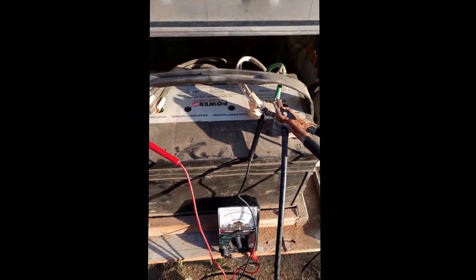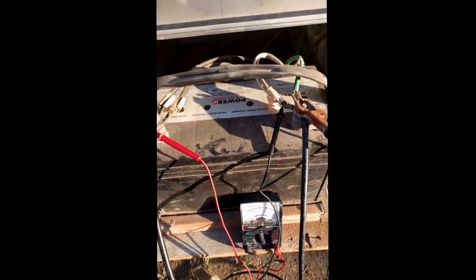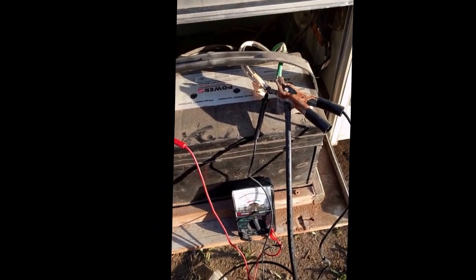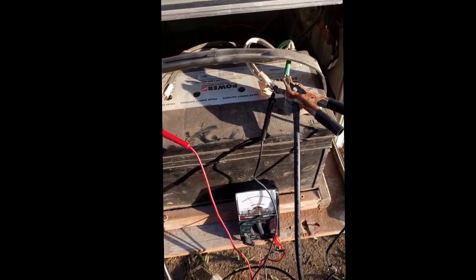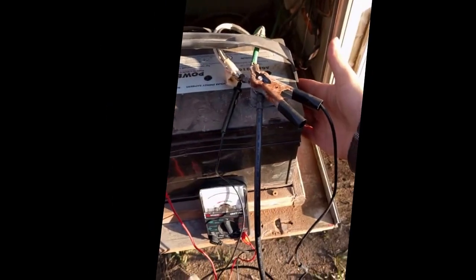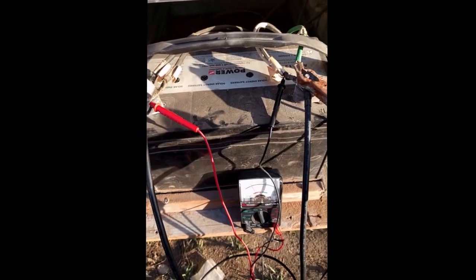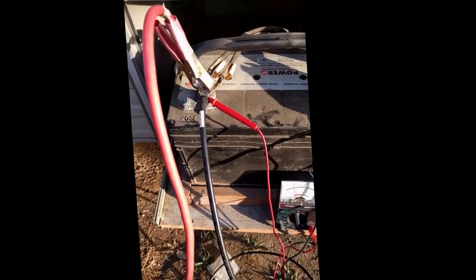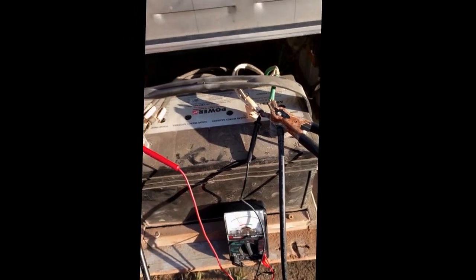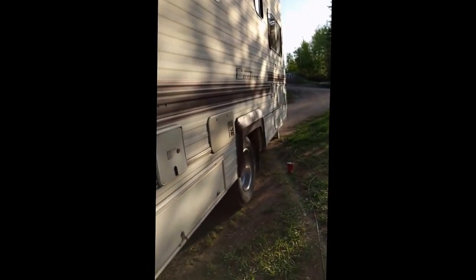I certainly lost capacity, but in tracing the wiring I discovered that the charge converter — which keeps this accessory battery charged for the caravan — is wired only to charge it when I'm plugged into AC grid power, which I don't do very frequently. I guess I do what's called boondocking, which is where you just kind of live off the land.